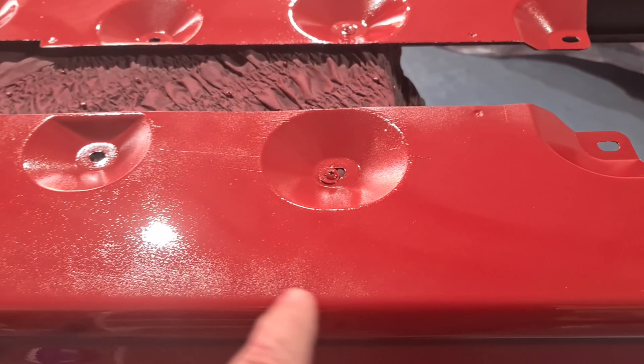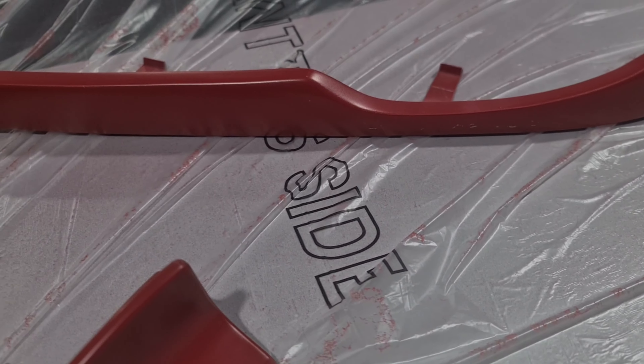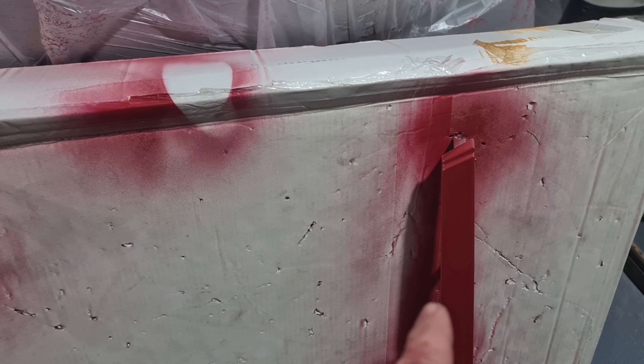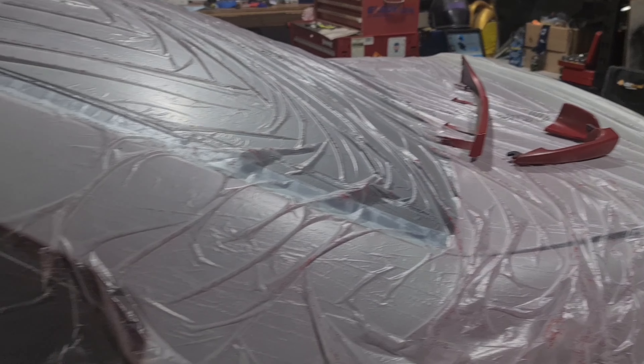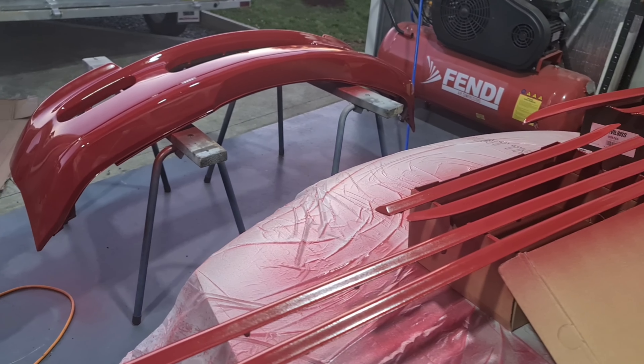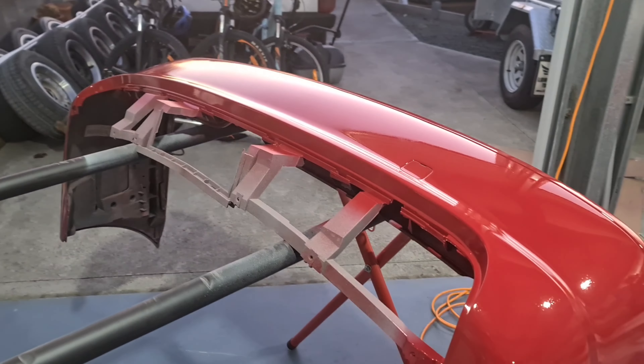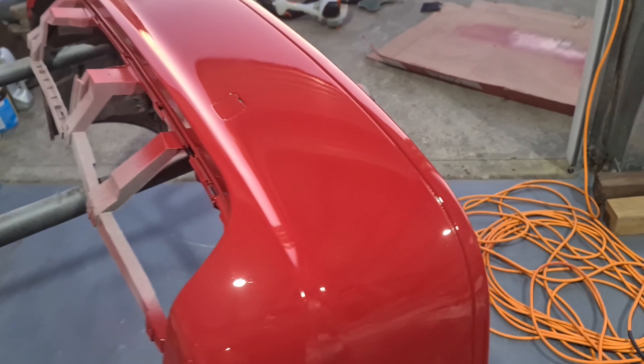You can see it's a little bit dry over there — we'll get it looking good on the second coat. That's what it normally looks like when it's dry with base coat. I'll mix up more red when I paint the car, and I'll do these handles and those bits that go under the headlights, and the little shark fin. I've just given it one coat of clear — I might do three altogether, because there's only an MS clear rather than a high solid.